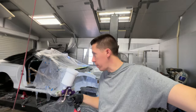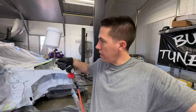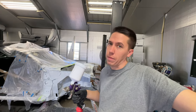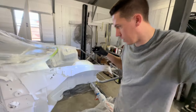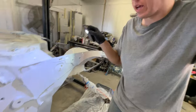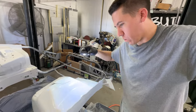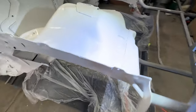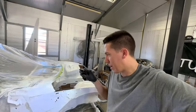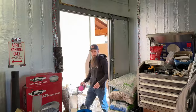It's been about 15 minutes. I aired out the shop a little bit but keeping some warmth in it, got some windows cracked, and I've still got some paint in here so let's go ahead and spray this out for number two. I'll probably have to mix up some more for round three. I called up Trevi's Customs and he's going to run over here. He's saying he thinks I should lay it a little bit wetter to get kind of the texture you'd hope for, especially with the single stage, so when it dries it dries really nice and glossy. It's kind of wet in spots but he's thinking it should be a little bit wetter. He's actually going to run over here real quick and help me lay the last little bit. I'll mix up a little bit more and we'll spray one more round.